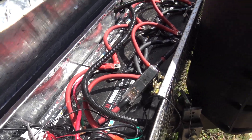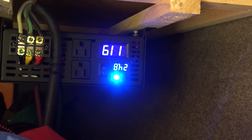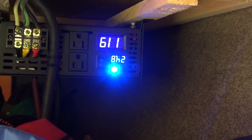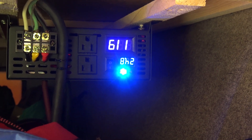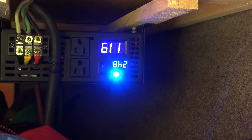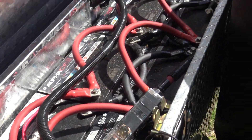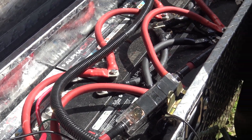What you're seeing here is it actually works. I hear the inverter running — the AC just kicked back on. We're at 24.8 volts, that's roughly 12.4 per bank, 119-volt output. If I look at the app, I'm usually pulling in during the day from about 10 to 3, about 800 to 1,000 watts in full sunlight — that's about 40 amps of charging at a 36-volt solar array. It is 72 degrees inside my RV with the air conditioner running full tilt. Both TVs are on, my laptop charger is plugged in, my refrigerator is on. The voltage will stay right about 24.8 as long as I'm in full sunlight.